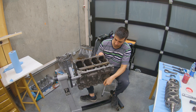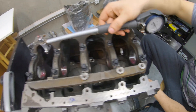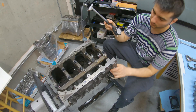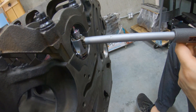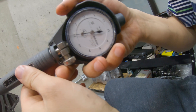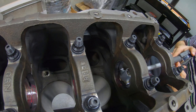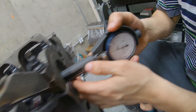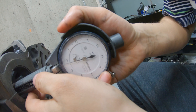I'll start off with measuring the crankshaft main journals. I'm going to only show you guys the first three — I've obviously checked the last two. To check the last two, you'd take it off and put it on the table. So let's check these clearances — they should all be around 2 thou. We got 1.9 on that one — that's acceptable, always aiming for 2. Next one came in at 2.1, and this one is just under 2.2.